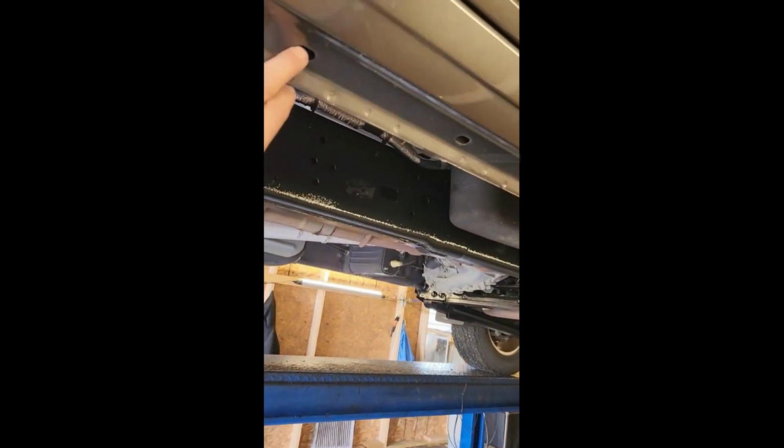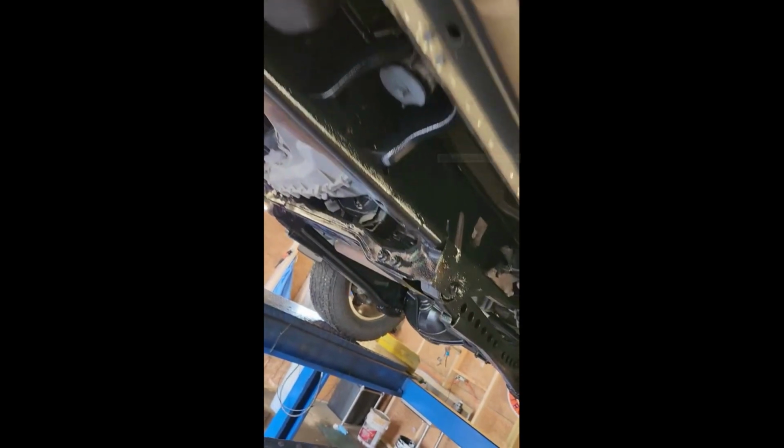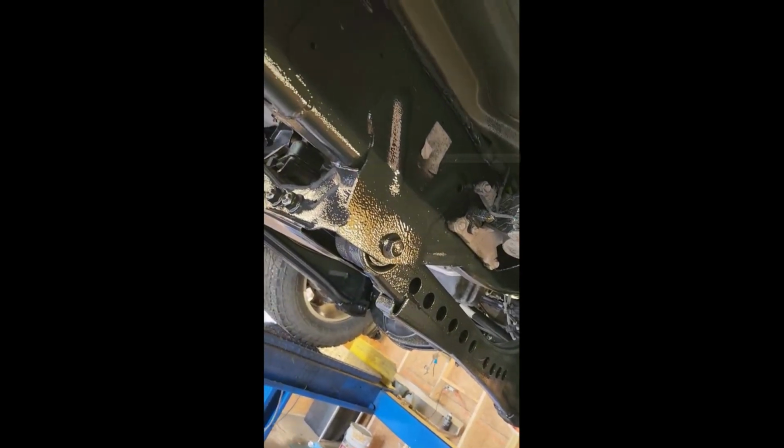On this one, you can see we pull these plugs out of the rocker cavities. We're going to spray inside here. There's rocker cavity plugs inside here. This side's been sprayed already. And as you can tell, it looks nice. We try to do a detailed job when we go around and not hog everything up. We'll just walk around this vehicle real quick.